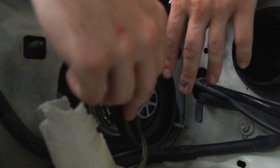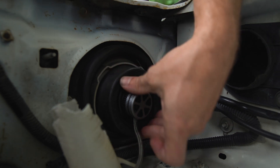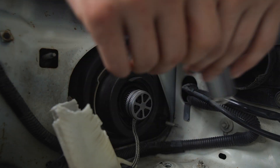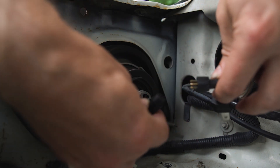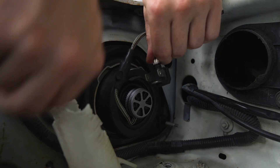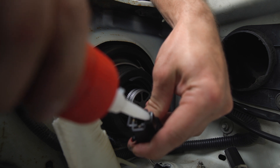I finally got the clip seated, so now I just need to invert this rubber casing back — which is actually kind of tough now because I've removed all the grease and oils and it's clean rubber, making it harder to push over. Next, we take the driver and connect the smaller pin side to the cord coming off the LED itself. All we have left is our three-prong, which goes right into the factory harness. Add some dielectric grease just to keep moisture off the pins.